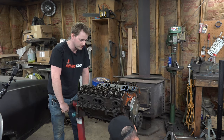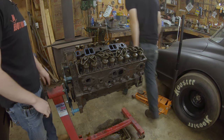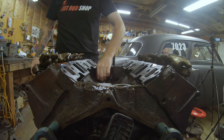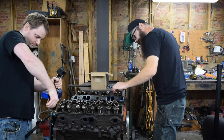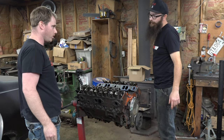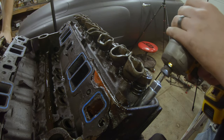With the 350 you can kind of hear the cylinders bobbing up and down a little bit more in there. It's hard to explain — the 327 just has a little bit smoother of a sound to it. Anyway, the lifters come right out so that's kind of a good sign. What heads are on this thing? They're like 187s I think — tiny little stockers, way smaller than 194s.